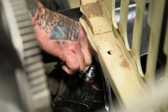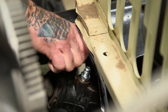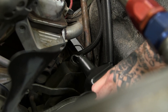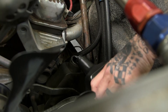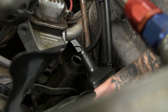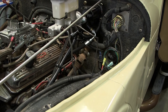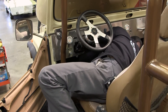One thing you really want to be clear of: if you've got a radiator, make sure the lines don't interfere with the bottom of it. Like the brake system, be sure to use a real high-quality fluid for the power steering as well — this will prevent any squeaks or noises coming out of the system. I'm turning lock to lock to bleed the system out. After bleeding the system, all that was left was to hook the pushrod to the brake pedal.